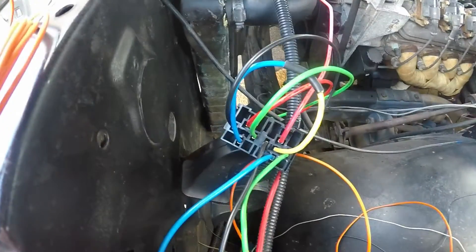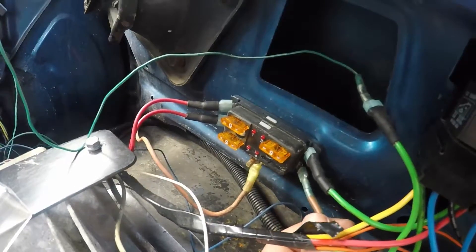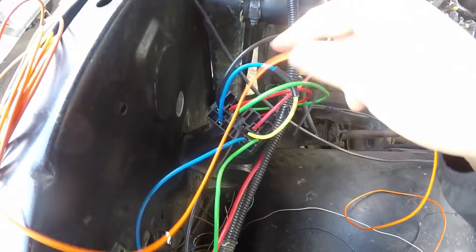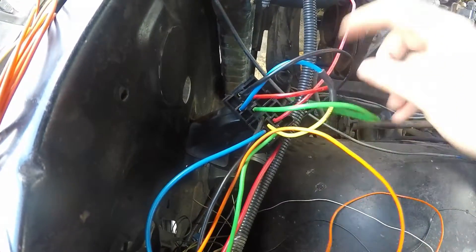So that way, if I turn the high speed on manually, it'll shut down the low speed so we're not double-powering. I just added this wire here — it's the ignition power — going to be the power for the low speed fan, and the ground will be from the ECM.